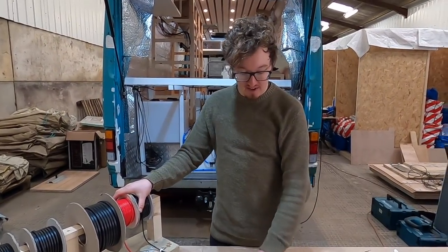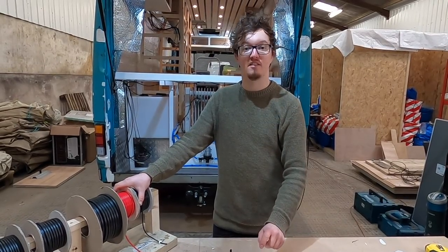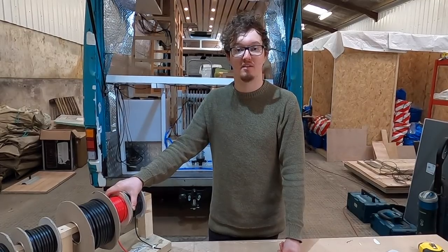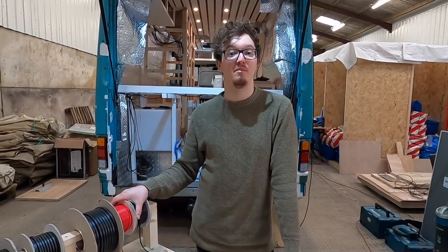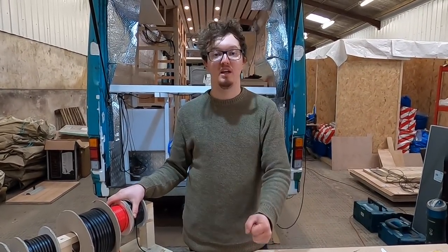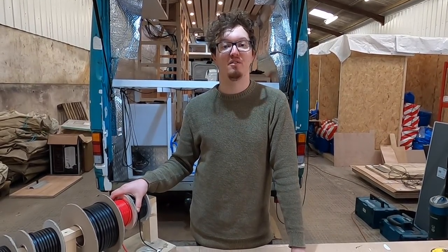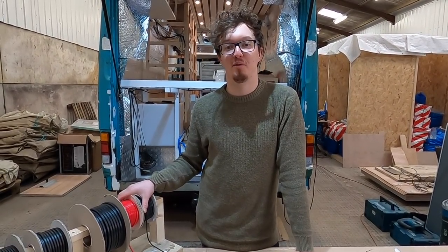So now we've worked our way down our list, looking at all our fuse sizes, unit sizes and cable lengths, and worked out all the different gauges of cable we need to connect everything. We need some pretty girthy cable for our battery connections, which is 50 mil squared, which covers up to 345 amps. We need some 25 mil square to connect our multi-plus to our batteries, which covers 170 amps. So we've just put in an order for all of that stuff.